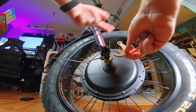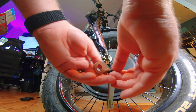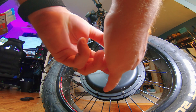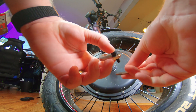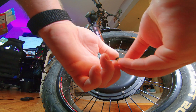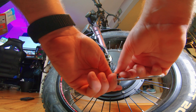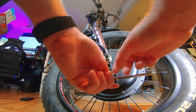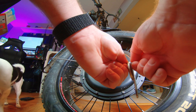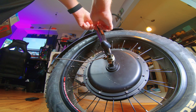It's holding on the rim and holding all the pressure up here if that bolt were to ever fall off. So you have your bolt, this piece goes this way, then you have this piece that goes through here, and that little piece for the hose clamp, then you take this locking washer and then the bolt. There's another piece here — I think that's just in case you need it for clearance, because you're basically affecting the brakes by doing this, so we'll have to make sure all that's good. We're going to unplug this cable, just pull this out.